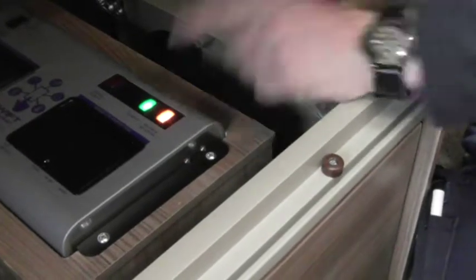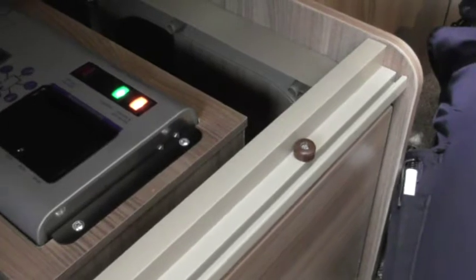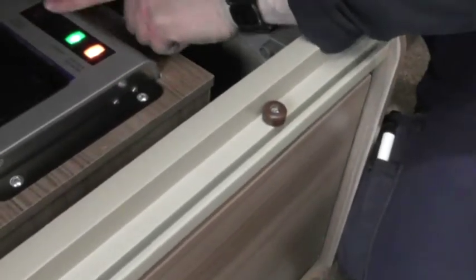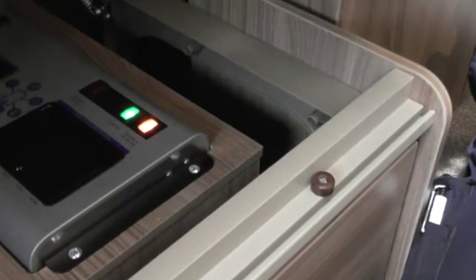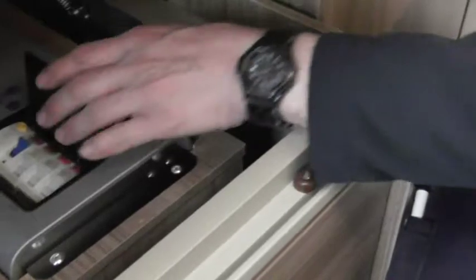Also check you've got your electric plugged in and the bollard switched on, because the bollard may have tripped as well. The green button is the charger — so your charge unit is there. With that switched on and 240V connected, your electric cable connected to the outside will charge your battery. We've also got a reverse polarity light — unless you go on the continent you're unlikely to see that. On the continent they wire things slightly different, and that will light up because of that.